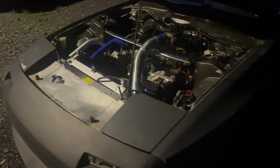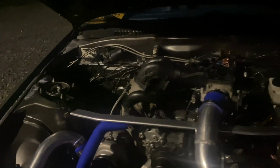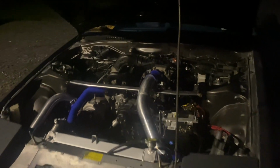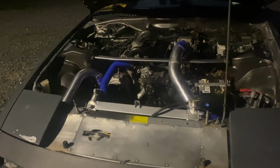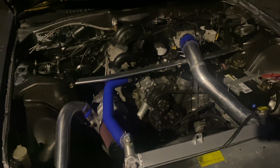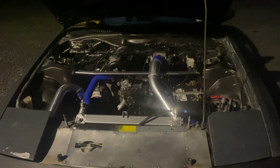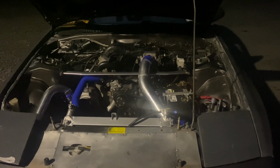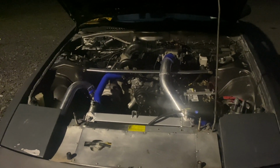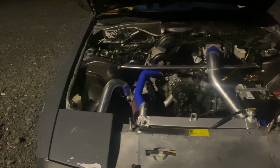But so far so good. Plenty of torque. Then in the ECU, I have to hook up the SSV valve and the VDI and use those properly, and then we'll pick up some bottom end power, because right now they're just wired open. I've got the 6 ports closed for right now. I'll figure out something for that at some point, and then use the whole RPM range with this thing instead of dropping off at like 8,000, 8,500 right now. But yeah, I'll have more as soon as I get a few more parts in. So that's where we are at the second.